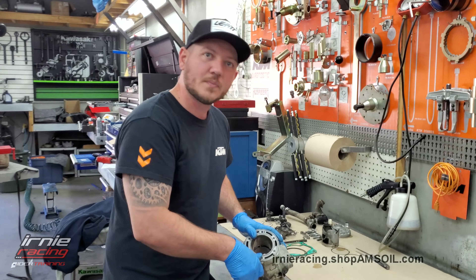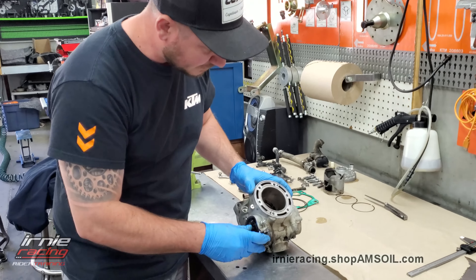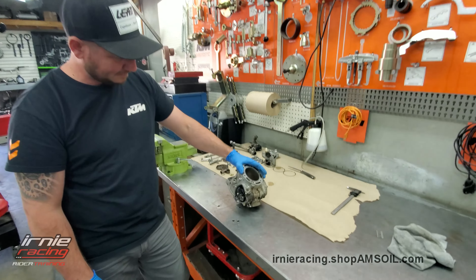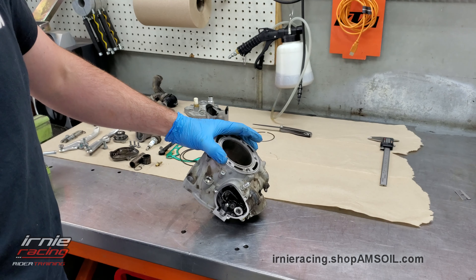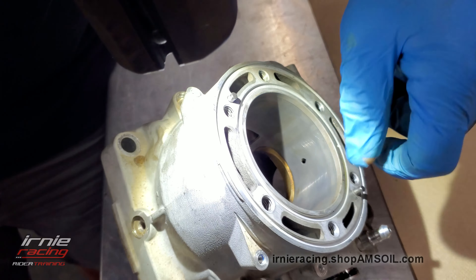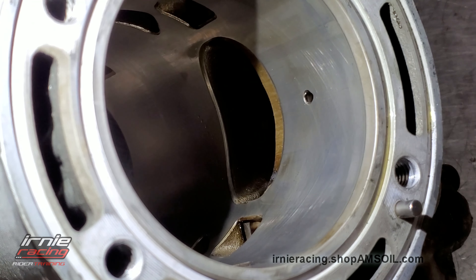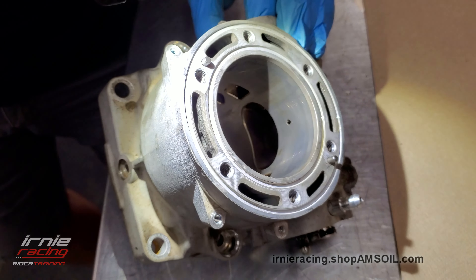It's really hard to ride a two-stroke that way - it's like old school. Most people don't realize the new two-strokes are so smooth - they think you've got to ring them out. It's a tractor. Keep it clean. You've got your main exhaust port and it's super clean like you said. And then you've got two little ports on the side - as soon as it opens up, you've got your center port and two ports on the side opening. That's where all your power comes from.